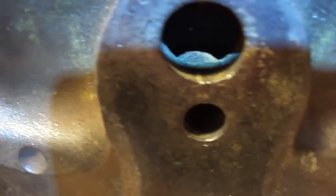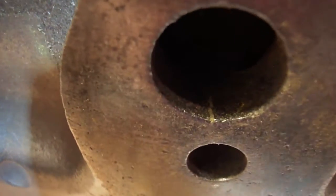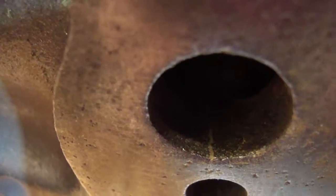The other crack was on the inside of the water jacket lining in here. You can see the magnetic flux lying right through there. That's the other crack that he showed me.